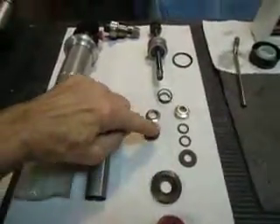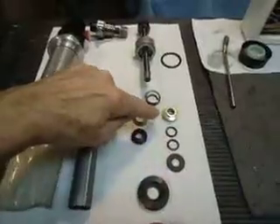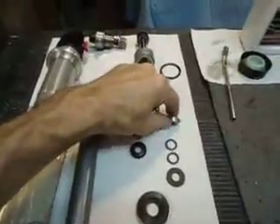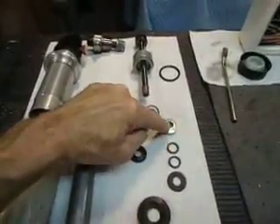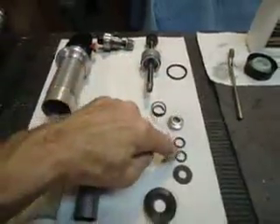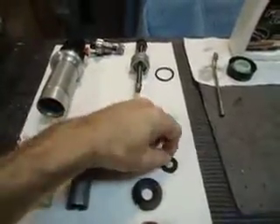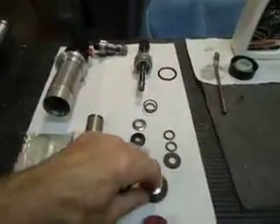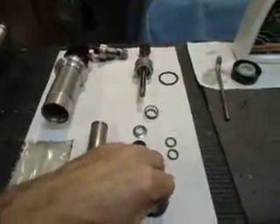This is the old seal which I can't get — it leaks. And this is the new seal that I made. I can't machine rubber like that, so I machined a housing out of stainless steel, very precisely machined, and these two o-rings fit inside it pretty snugly. They're going to fit over this plunger pretty snug, which is going to prevent the leaking. Then I need this flat washer here to seal this device in the cap — between metal to metal I have to have a seal.